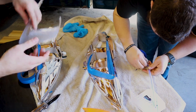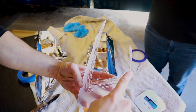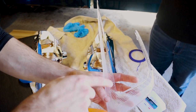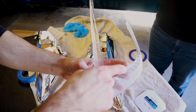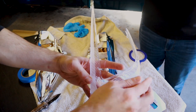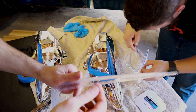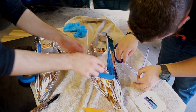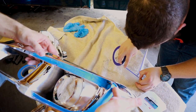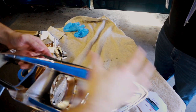What Kyle's doing right now is using fine line tape, and we're essentially taping off this clear piece here that matches the actual shape of the C-light really well. And then all this smoky weird stuff on the outside is going to be painted black. So we're going to have a thinner, more recognizable, more distinguished C-light. On the actual headlights themselves, same thing: the reflector around that C-light, we just want that accented, so we're going to be taping that off. Everything else is going to be black.